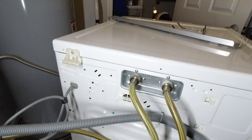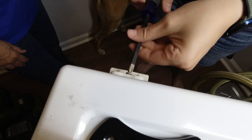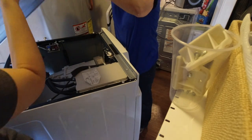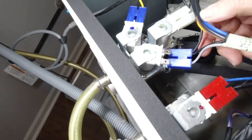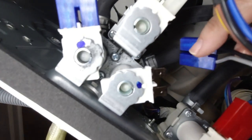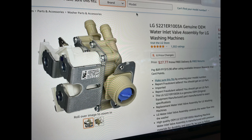That's when mom said, look at these brackets — they seem like they can be removed and we might be able to remove the top that way. We found that the top did in fact slide off once the brackets were removed, and that's when we found the leak. There was some water around the edges of this part. I saw a part number, took a picture of it, googled it, and found out it was the cold water inlet valve — about $28 to replace.